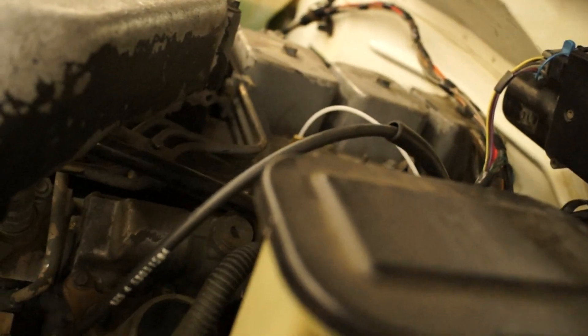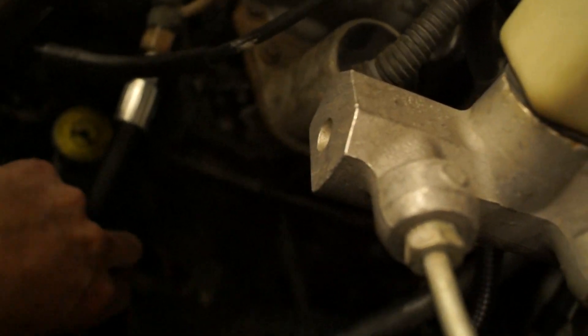The other thing I did today was got my tach working. Before I show that, I want to show how I set up my fuel pressure gauge, because people don't always know how to do this with these old P7100 injection pumps. You run a gauge snubber — mine is from Torque Tech — which has a very small calibrated orifice drilled in it. Then I had this hydraulic hose made at a parts store, and it loops up here and attaches with a little clamp.